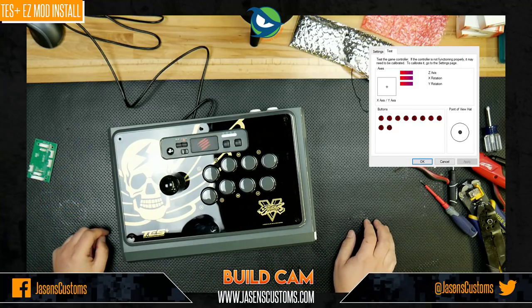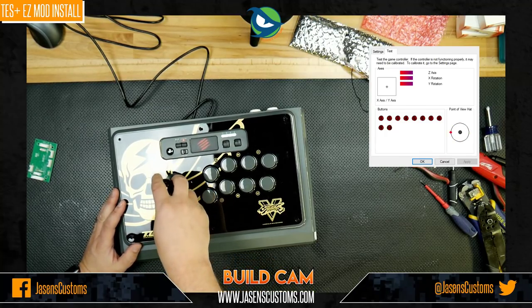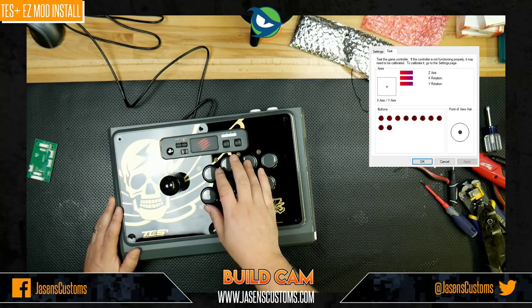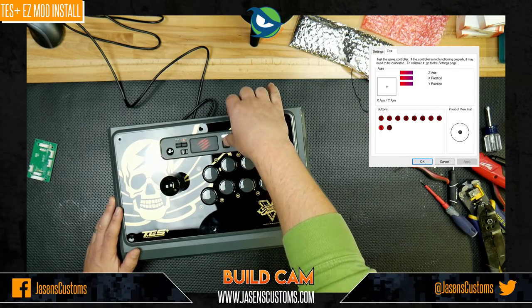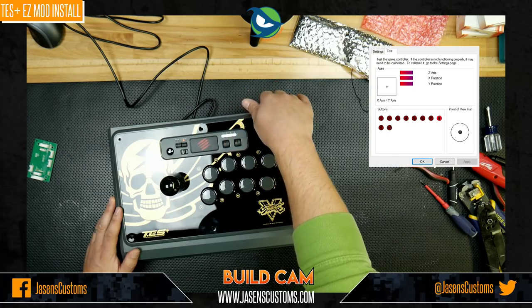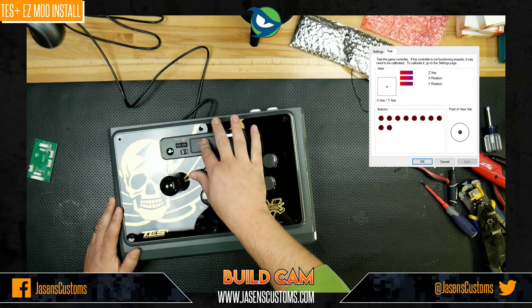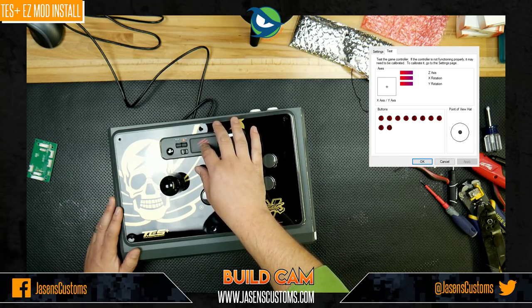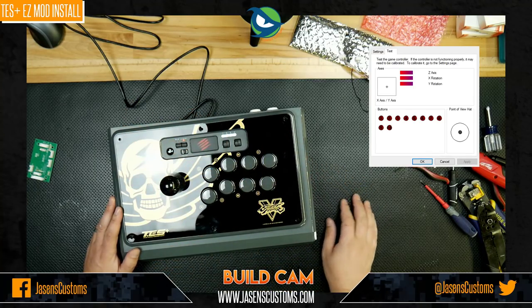So what we did is you guys can see everything. There's no trickery, no big deals. First thing I do is I test the lever, no problems. And then I test the buttons, you know, square, triangle, R1, L1, then X, circle, R2, L2. Then we test the L3 button, the R3 button, start, select, touchpad click. Oh, touchpad click doesn't actually do anything. Wait, does it? Yeah, it's supposed to. Maybe I don't have that ribbon cable connected properly. We'll have to check that. And then the PlayStation button opens up the game thing.